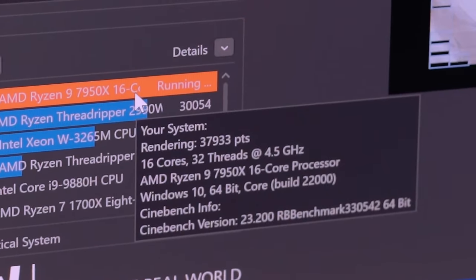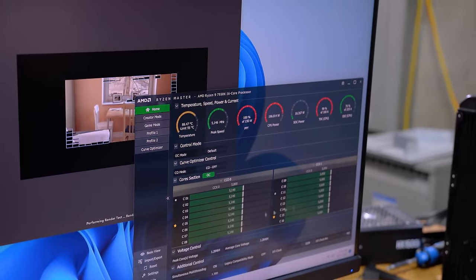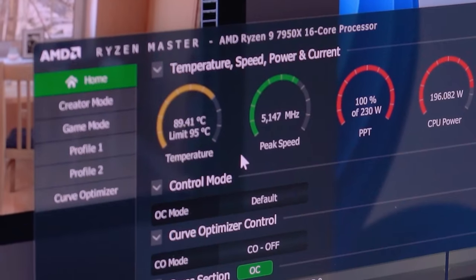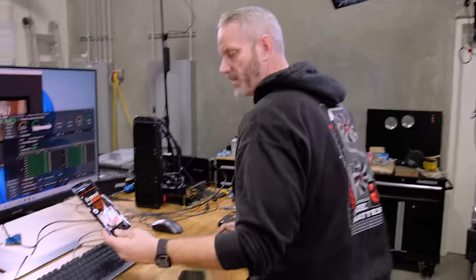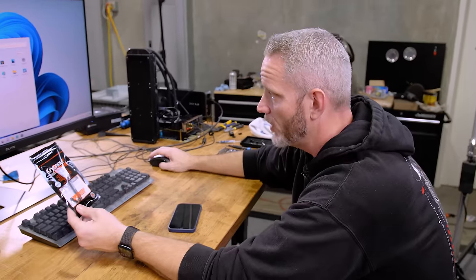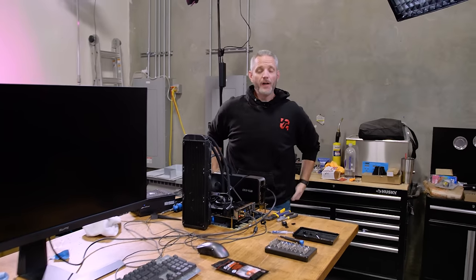We're at 5.14 and 5.069 GHz - slightly higher, about 30 MHz higher on each CCX. We're not getting the full 5.2 because we're hitting the PPT limit. With PBO enabled we might actually hit 5.2 all-core. The Cinebench score is 37,933. My first run when it was actually colder was 38,050, so we're within the margin of error. There's no performance improvement right now since clocks haven't changed, but temperatures are down. We came down from 94C to 88-89C, which is better. It's not exciting enough to void your warranty for 5C, but Der8auer told me his results were up to 6C - probably with his thermal paste.